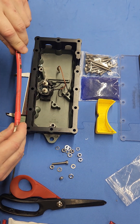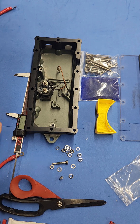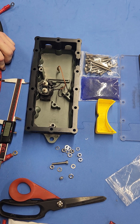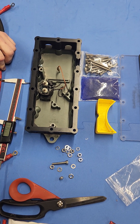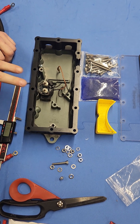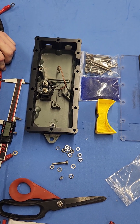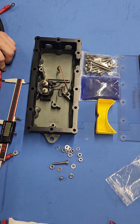The other end is going to be the feed to the starter. So you're going to measure those up — we're aiming for somewhere between 110 to 120 millimeters. You can use 90-degree terminals to go straight to it, but we like a little bit of a curve. So we're going to go 115 millimeters and cut it.